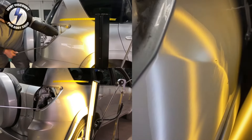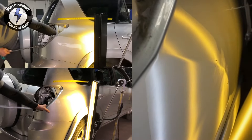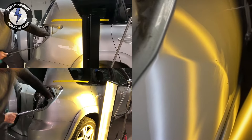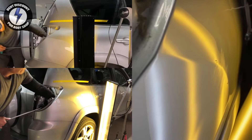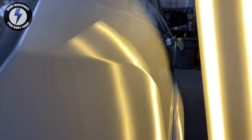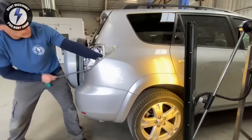I'm going to be manipulating the crowns with knock down tips. I will be using my wide tips for knockdown along with my sharp tips. I will go through the panel to gently knock down the crown to smooth out the metal. With a PDR rod, I need to be careful not to push too hard or I can create more damage. I will use my sharp tip to bring up the micro lows.